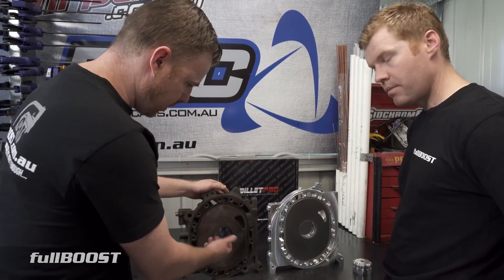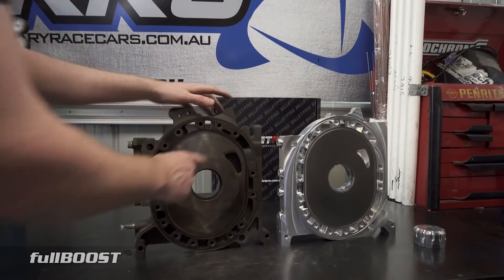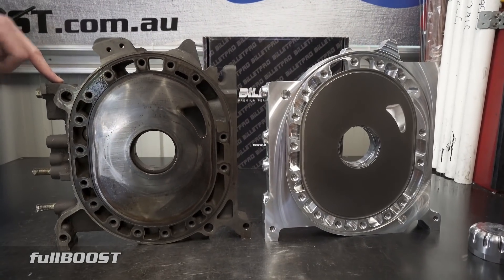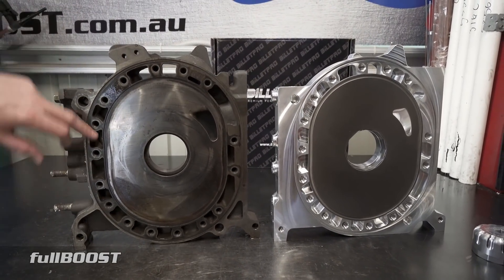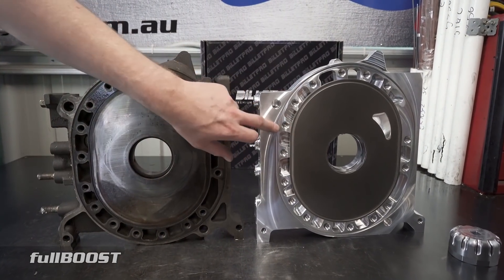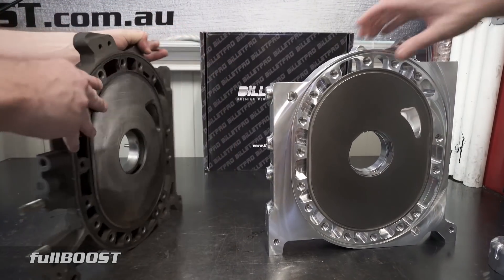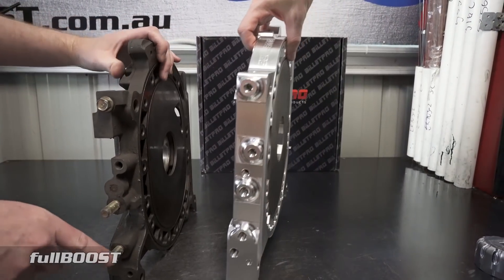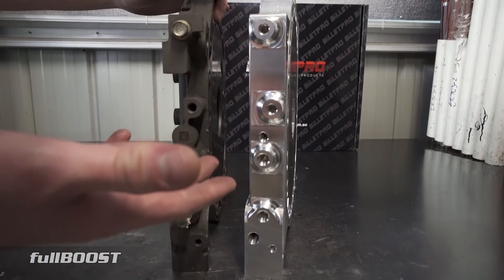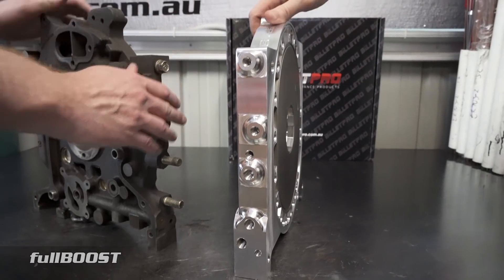They're very similar. You've got your intake port here, the same mounting lugs up here, oil ports here and here, the dowel, and then you've got the threaded holes for all the through bolts all the way around, two water seal grooves. It still accepts all the accessories as per the factory plate — it's essentially just a replica. This could be used in a street or race engine.